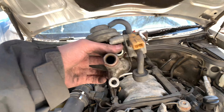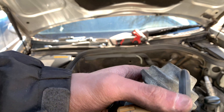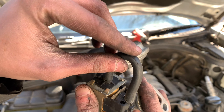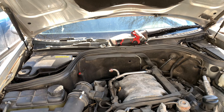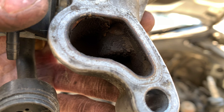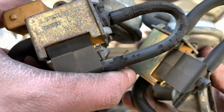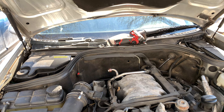I'm a little bit out of my league here. This hose right here looks rough — every hose in here looks like that. Here's the new one. The new hose is in way better condition — these hoses look a lot nicer. The old one doesn't look too bad on the inside, but comparing left to right, this old hose is in the worst shape. My guess is it created a vacuum leak or something.